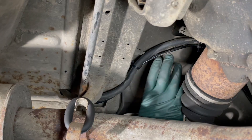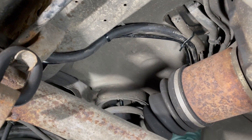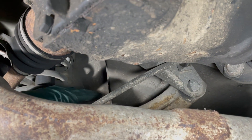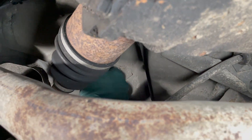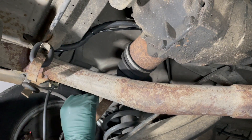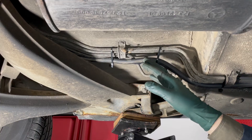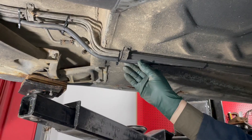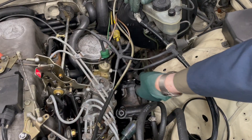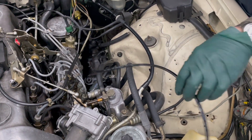I've zip tied it to the brake line to keep it up high over this axle, and then I come over and start following the factory fuel lines. Right here I have to go over the top of the subframe — you can't go underneath because you'll get too low and possibly have interference problems with the control arm. I fed it from the other end first, up through and over the top of the control arm up into the tank, then moved the rest of it forward. Once over the subframe, I'm just following this bundle of factory fuel hard lines using zip ties all the way up front to the engine compartment. Here is where the fuel hose ended up. I left the wire long — we'll wait until we get the wiring fuse panel set up, so this is just going to be set aside for now.